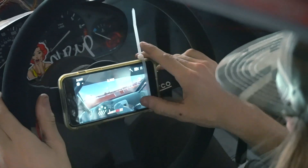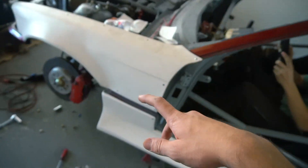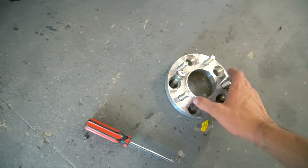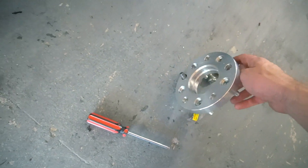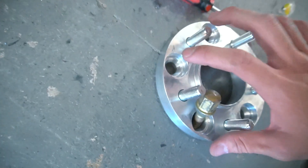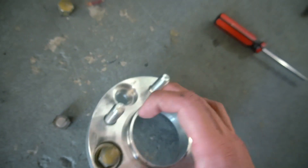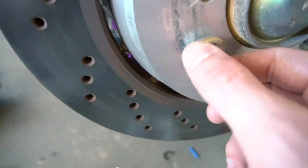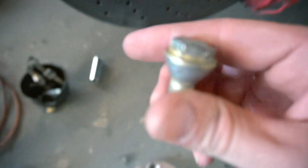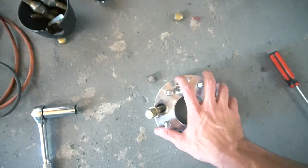Thank you to our sponsor, Torque Drift. Today I'm working on the E36 — I finally got these wheel adapters. They're custom because my wheels are 5x114 and my hubs are 5x120, because they're German. I need it hub-centric. The way it is, when I have my lug nuts holding the adapter onto the wheel, they stick out too far for the wheel to fit flush. So I had to go through and cut all my lug nuts — they're stubby, but I had to make sure the ratchet still worked on it. Short, stubby lug nuts, and then they fit flush now.